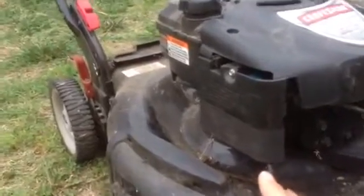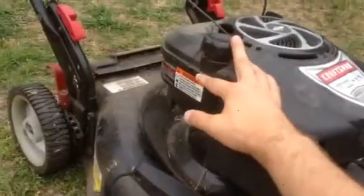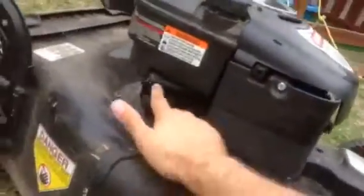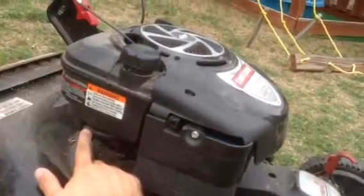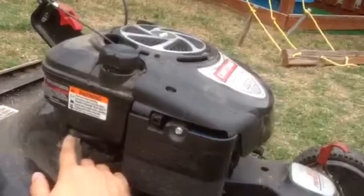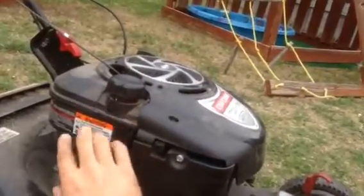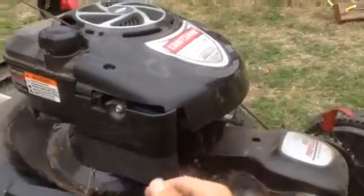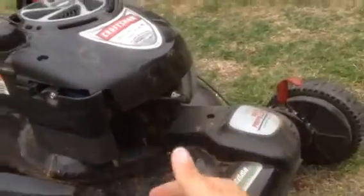The other noteworthy thing I did since I had the whole thing disassembled: I filled the fuel tank with water, then blew on it, and out the bottom came a little bit of residual dirt that had been sitting inside the tank. I think what ultimately happened was dirty fuel got in, went down through the fuel line, got into the carburetor and gunked it up — and it would have just happened again if I hadn't cleaned out both the tank and the carburetor.